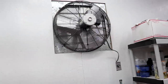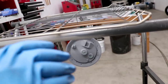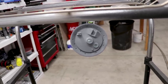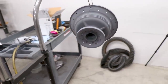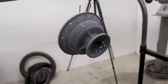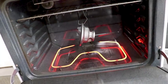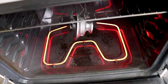Man, it sure is nice having that exhaust fan in here - you can literally see all the powder just being sucked right out and it's not even landing on the floor at all. So that's going to make cleanup and safety a lot better. I'm going to check this thing over real quick before I pop it in the oven to make sure I didn't miss any spots. Basically, you just want it consistent but without too much buildup. It looks pretty good. So for this color called Super Chrome, I'll be baking it for 12 minutes at 450 degrees - that's what Prismatic recommends. I'll be using an infrared heat gun here to check the part's temperature. Once it reaches 450 degrees, I'm going to leave it in there for 12 minutes and at that point we are going to have some chrome.